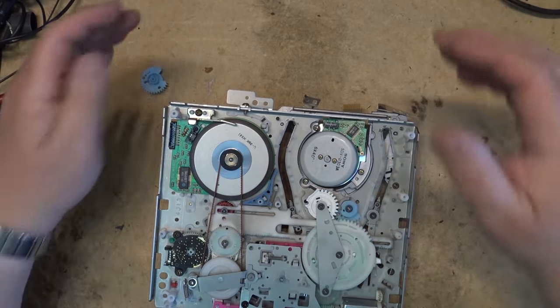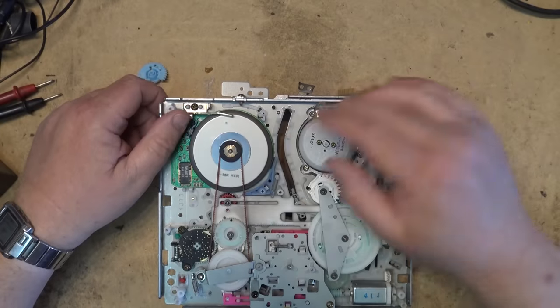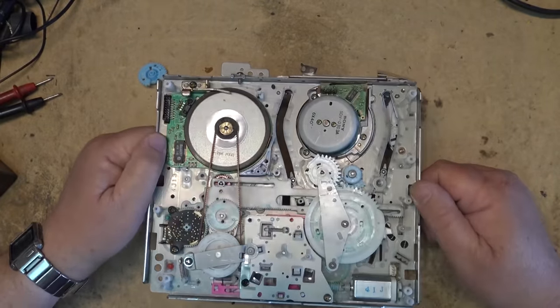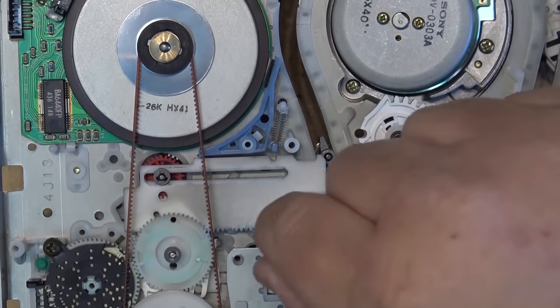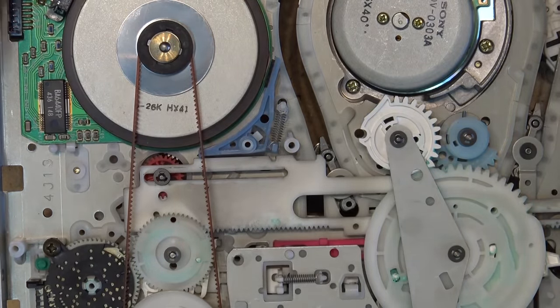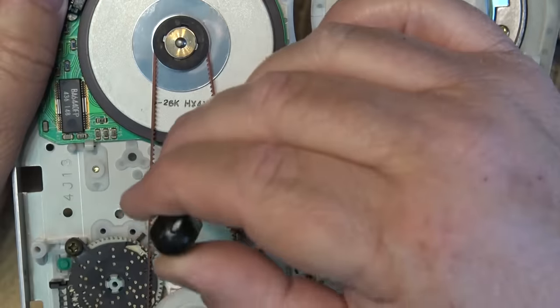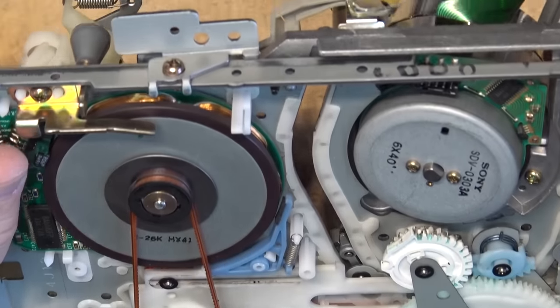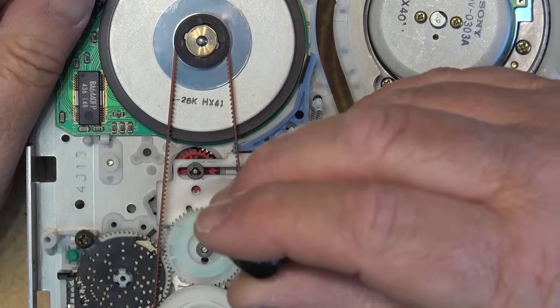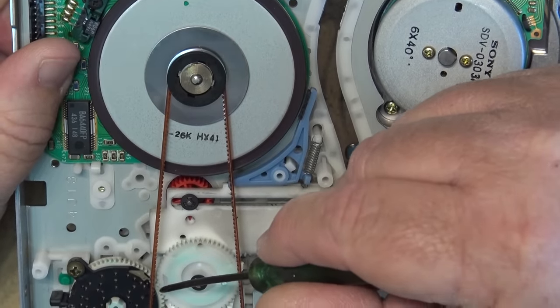These are pretty straightforward to change. We'll do the classic stuff — clean the mode switch and make sure that everything is to spec. We start out by noticing that the mechanism is in proper time. How we know that before I even start is by checking the actual alignment holes. If I put the screwdriver right down through the holes, it goes right down through the chassis — these are the alignment holes that tell me the mechanism is timed. There are also a couple of alignment marks over here that point at each other to indicate that timing is correct.